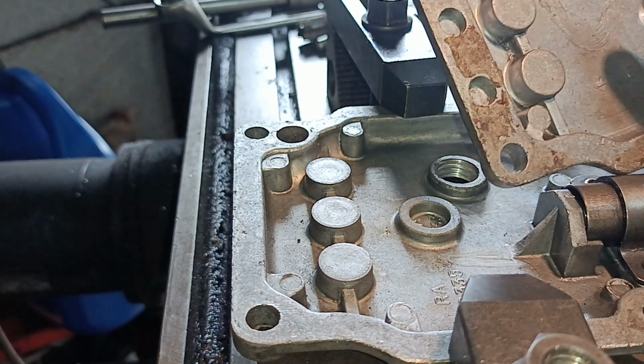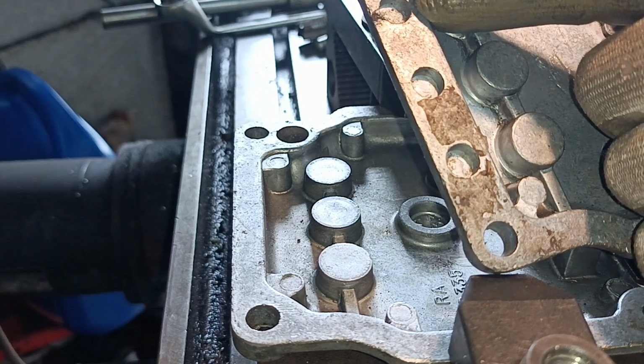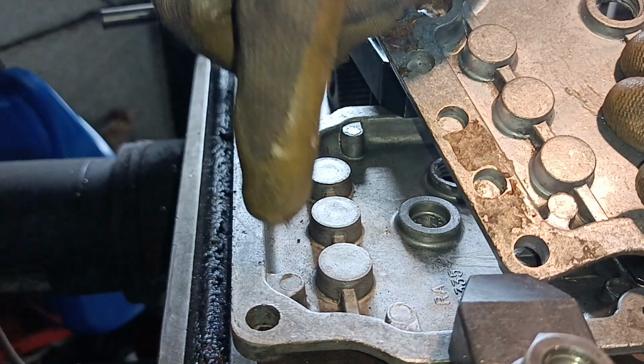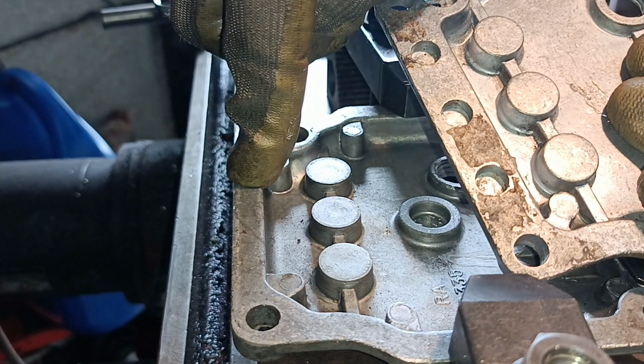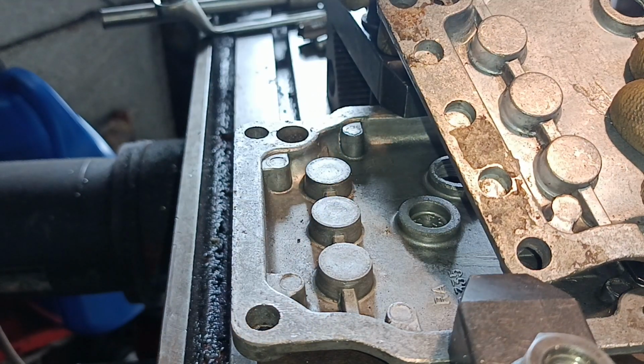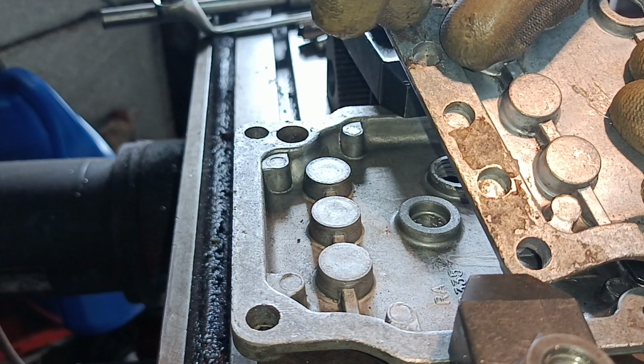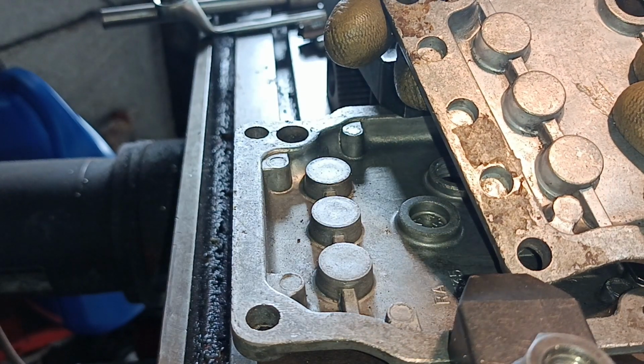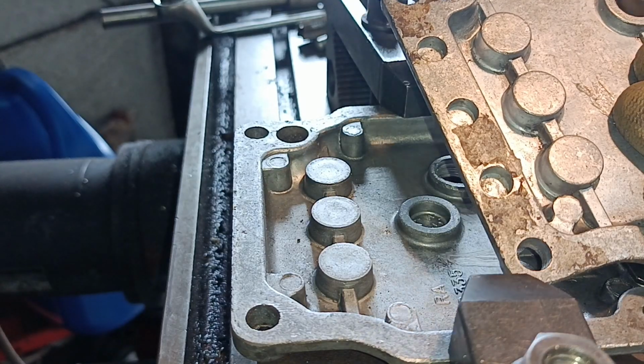Can you see that this lid has 3 counter bores there, which would be in that surface there. I think I'll manage without. I've never heard anybody else mention them when swapping the lid. It just means that the spring for the detent will be squashed a bit more, which might be a good thing. It might increase the detent feel.